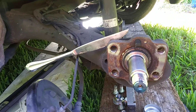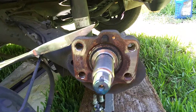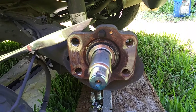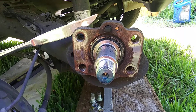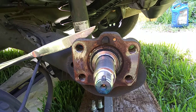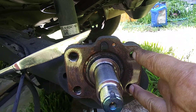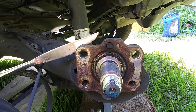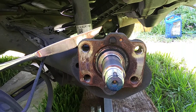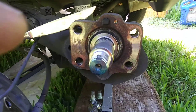I checked and checked and checked, and finally decided to just install shims — which are actually not shims, but washers. I went to the hardware store and bought a few different washers. I calculated the thickness: one of them was about 1.2 millimeters. That distance right here is 50 millimeters, and I checked the camber — it was like three degrees, very high camber.